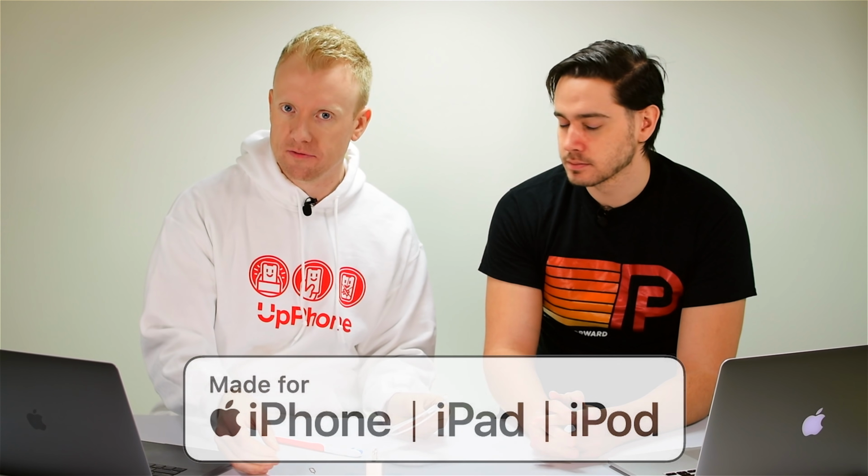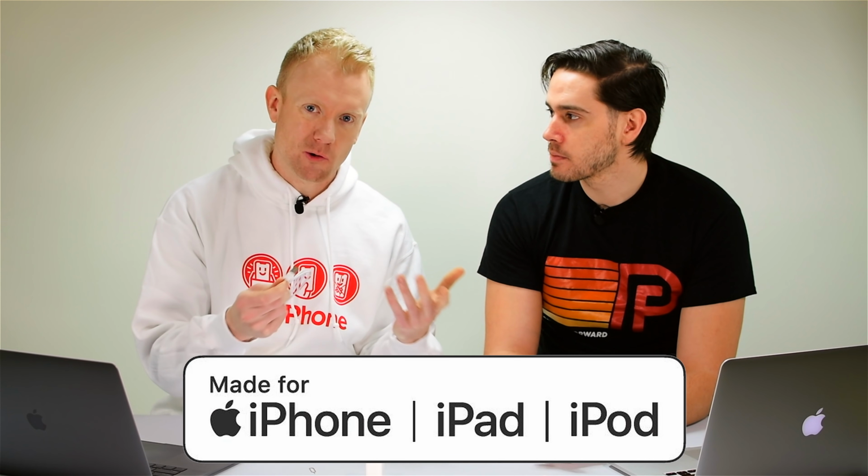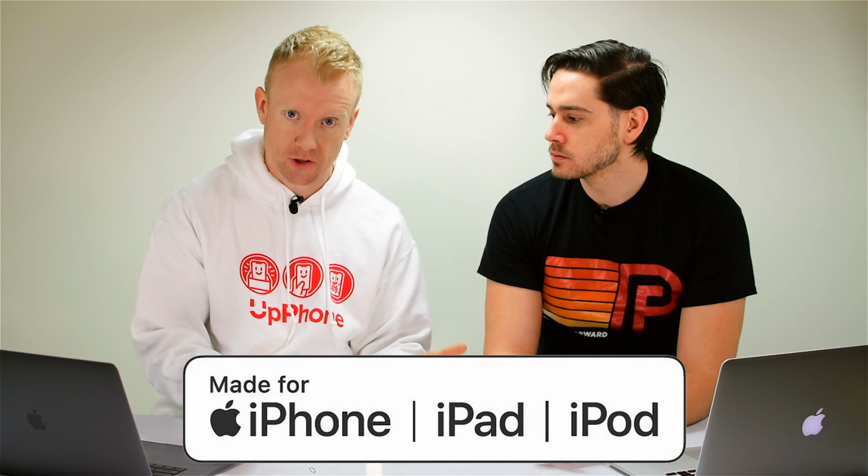And about cables: Apple cables are MFi certified, and so are some other brands, but not all. MFi stands for Made for iPhone, and Apple builds a chip into these types of cables that the iPhone recognizes, and it says to itself, hey, this is a safe cable for me to use to charge. If you're using a gas station cable that you bought for $2 and it's not charging, you probably need to buy an MFi certified cable. Amazon has them, like the Amazon Basics brand, but be careful on Amazon because some of those aren't MFi certified.